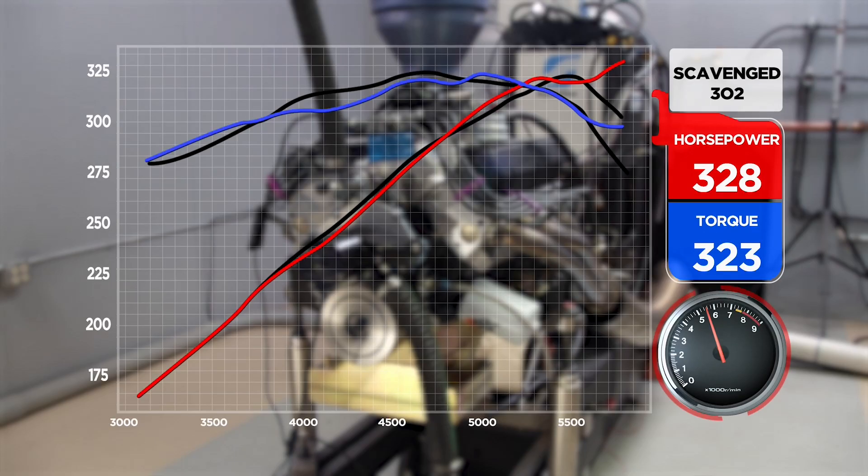That illustrates the difference between a dual plane manifold and a single plane manifold. Single plane made a little bit more power, and we'll see where it did it here. The manifold is a little bit better up top. They trade back and forth for torque and power down low. Almost the same, though — where the dual plane falls off a little bit, the single plane still wants to run. We're not optimized for what we're doing; this is a bunch of used parts, some stuff we just had laying around. But it shows that the single plane intake manifold will want to run higher in the RPM range than the dual plane, just because of the way it's constructed, its cross-sectional area, and how that actually works with the cam.